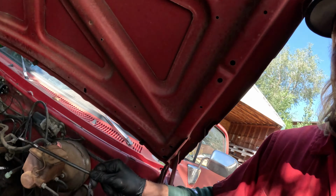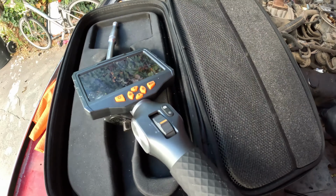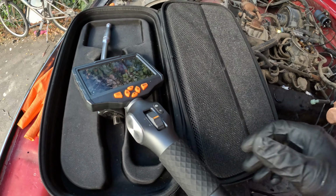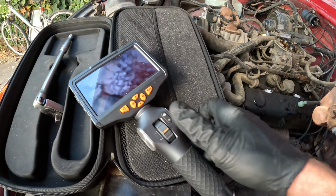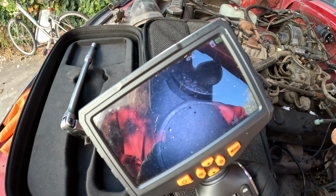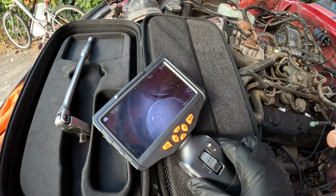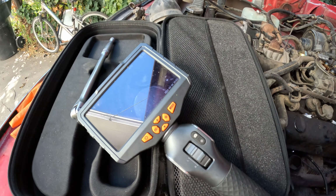Okay, I'm gonna say we've got a hanging valve right here. I tried to turn it over like 5 times and the cylinder was in the same spot every time. And I was like, no way. Thought the cylinder wasn't moving, but finally got it to go down. Just turns out it was stopping in the same spot every time. Now that it does though, I've got it in like 5-6 different spots now. This valve's been open every time. I haven't seen any of the valves open on any of the other cylinders. I don't expect any of them to be open, let alone that same one to be open every time that cylinder is in a different position. So we've definitely got a hanging valve there.